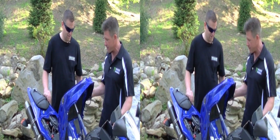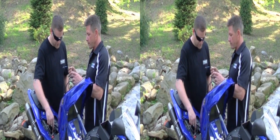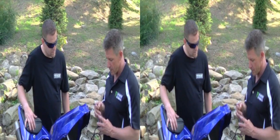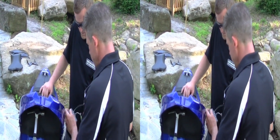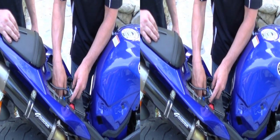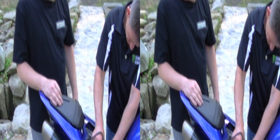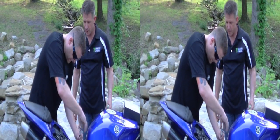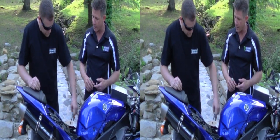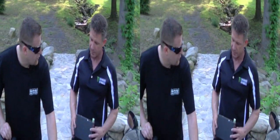We're going to lay this down beside the PC-5, and then we're going to use this jumper lead here — it's going to connect from one end to the other. You want to make sure you have clearance for your seat, so align the PC-5 and the secondary fuel module up correctly. Some people have the auto-tune in there too, so you've got to make a little bit of room. Donna did a really good job laying the stuff out, getting the ends just the right length to fit the motorcycle. Each unit has a custom harness to fit; this one works for the R1 and the R6.